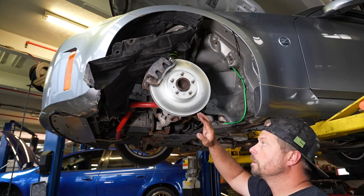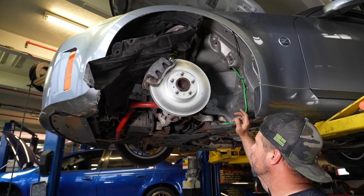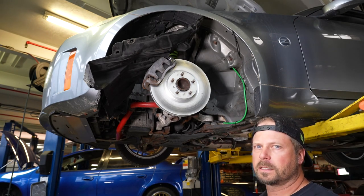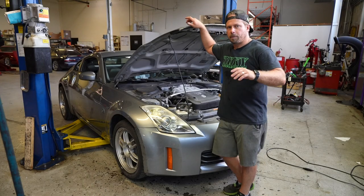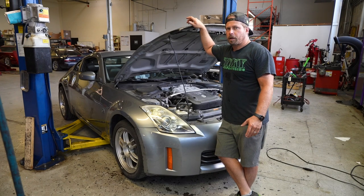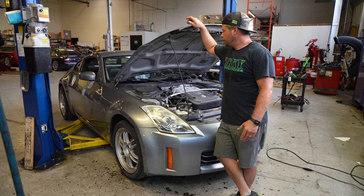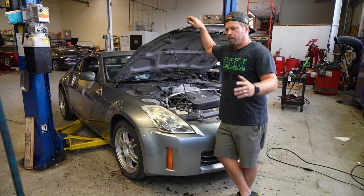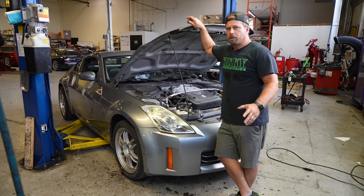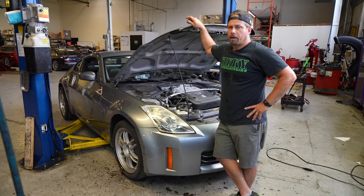All right, so lastly you're gonna reverse the removal of this fender liner, put that back in place, then you're gonna want to fill the master cylinder up and bleed the clutch out. Reverse everything, make sure you check for leaks, and then you're good to go — installation complete. That's a wrap on the Sikky clutch line install. It took about an hour including filming, so if you're not screwing around with a camera, probably get it done in 30 to 40 minutes. That crisp clutch is going to be worth the extra hour. If you want to check out the other products that Sikky makes for your Nissan, make sure you log on to Sikky.com or get in touch with one of our knowledgeable sales reps today. Thanks for watching.